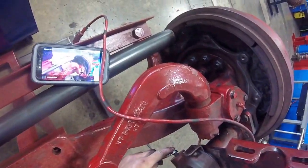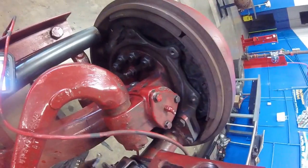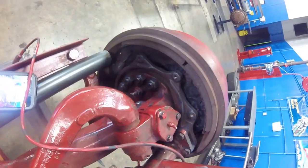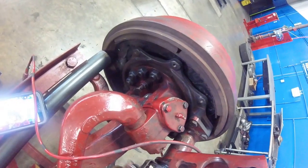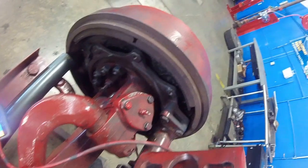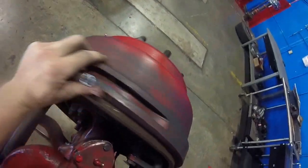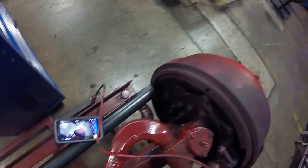That's how you do your brake adjustment. All you do is tighten up on it until it's touching the drum, then back it off about a half a turn — that's one quarter, then another quarter — so now we have sufficient spacing where the brakes will not drag, and the drum will spin freely until the brakes are actually engaged.